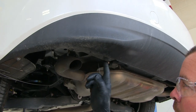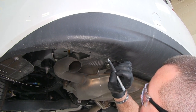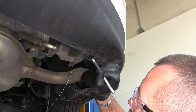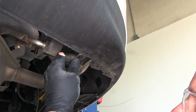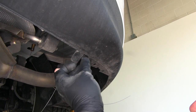Next, there is a little tab on the bottom of the fascia that we are going to have to cut a small section out of — on the driver side and the passenger side — going about like this. I am going to take some tin snips; you can use a razor knife if you want. These usually work pretty well. We are going to cut these tabs out.